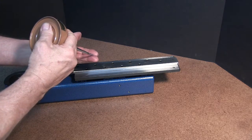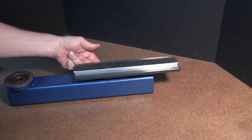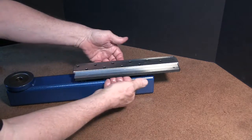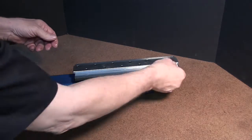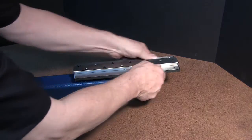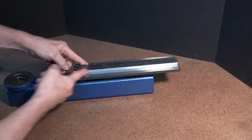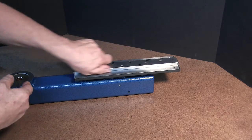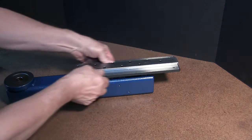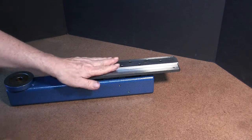A lot of people working with wood — the sawdust just soaks up the oil, kind of like cat litter, and it just dries up. So you want to make sure that each time you use it, you rub your finger on there with some oil so it's nice and well lubricated. Especially the sides here on this smaller one-and-a-quarter-inch piece — this is where your gib runs right on this rail. Some people use STP; it's a little thick but it clings and seems to do a pretty good job. The decision ultimately is going to be yours.